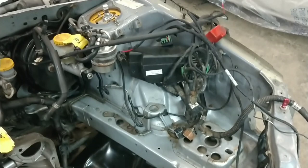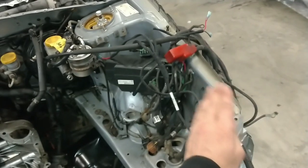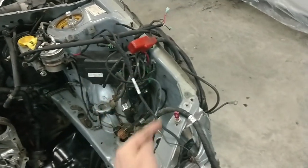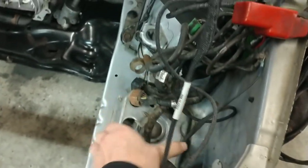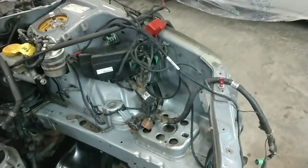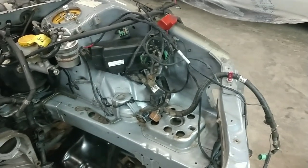We're going to start moving some of this stuff out of the way — starting with the actual fuel filter here, then moving over to some of these cords. A lot of them I just have draping over, and some can just move off to the side. My tub actually runs on the inside frame line, so you're getting all of this as wheel clearance where the battery used to live. Now, that battery is going to have to be relocated when you do these tub kits. A relocation to the trunk is probably ideal.